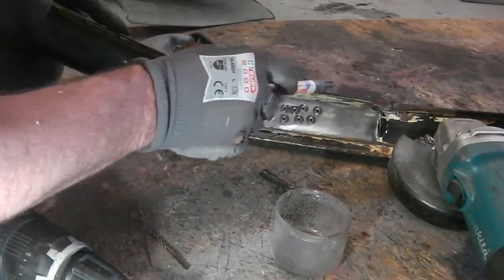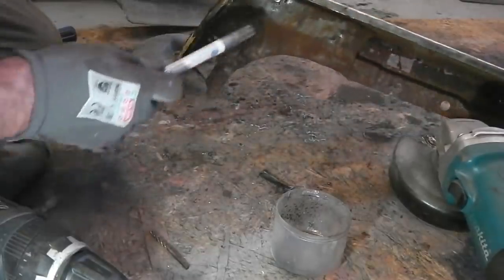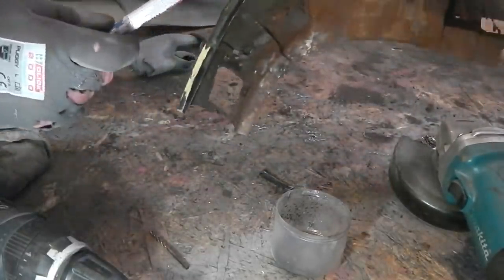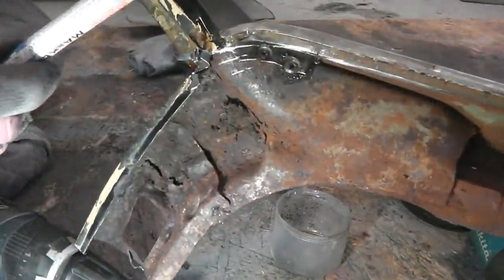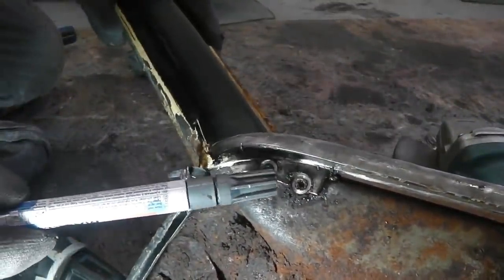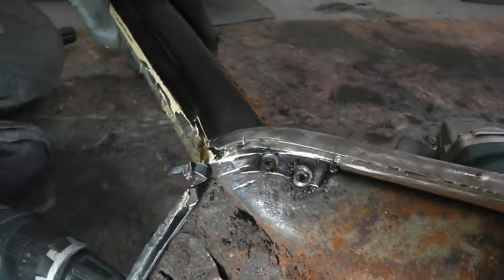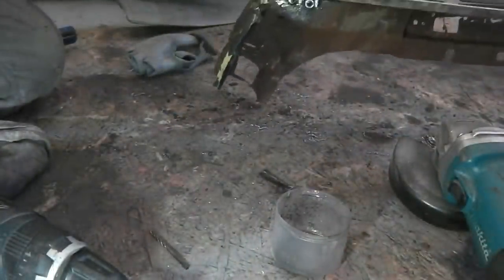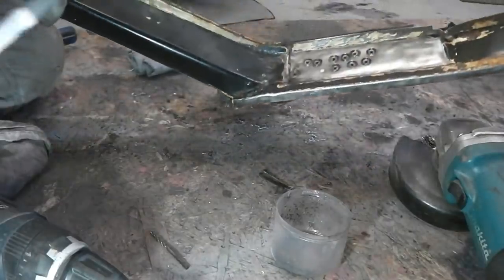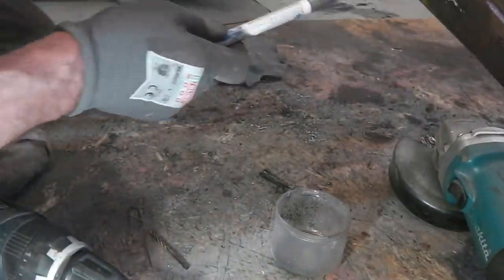And I'm going to get that top edge now as well. I've done this one. There's a little hidden tab. You've got to watch that hidden tab. Bringing it up for you if you ever do this: when your roof skin comes off and you're doing your gutter replacement like this, then you've got two there at the top. They're normally all right to get. Can't start really rocking that off yet till we loosen it up on this run coming in.